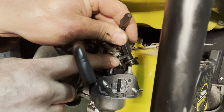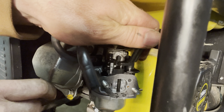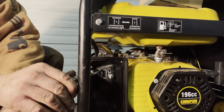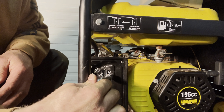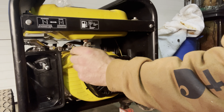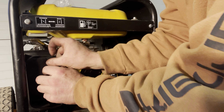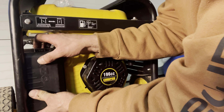Now you're going to install the choke lever. This pin goes into here, into the slot in this black lever, and everything moves. Put the air box back on. It is an aluminum carburetor and kind of a plastic plate that it comes up against, so you don't want to go crazy — just evenly tighten them. Now install the breather tube, install the fuel line, put the air filter in, put the cover on, and we are ready to give this thing a try.